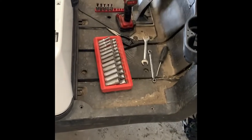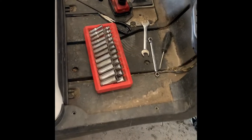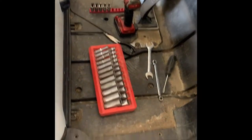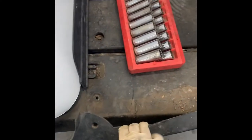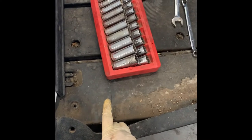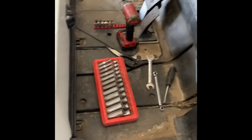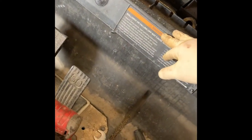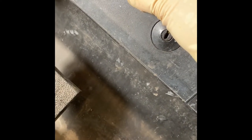The first step is to remove your floor mat, which I've already done. All you do is remove the two bolts on each side of the rocker panel, then pull it back and slide the floor mat out — the whole piece comes out. Then the next step is to drill a hole into the dash for our on/off switch. It's a one-half inch drill bit, and if you look there's actually a little dimple right there that tells you where to drill. So we're going to drill right through that.